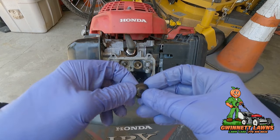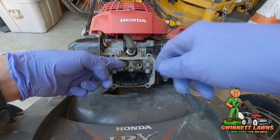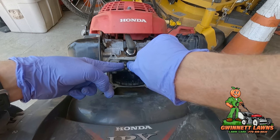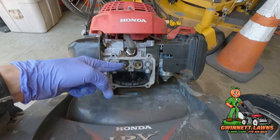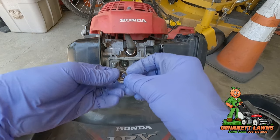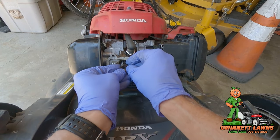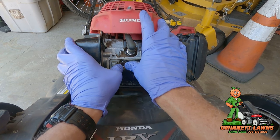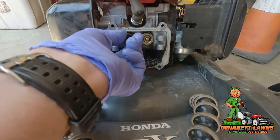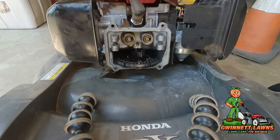I've got the piece here and I'm just going to stick it right like that. Basically what this is going to do is the spring is going to press on this base right here, and this inner part is going to keep the valve guide from coming out. Others have done it before and say it is enough pressure. There we go — make sure it's centered on both sides.